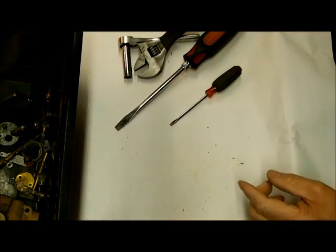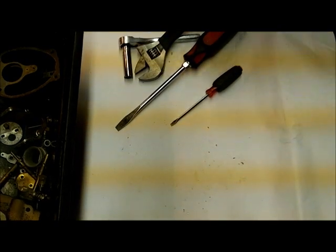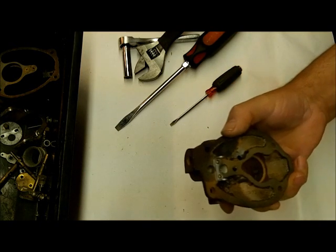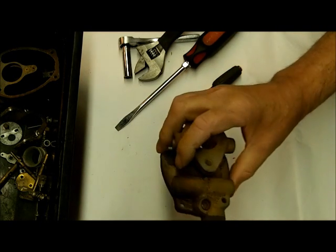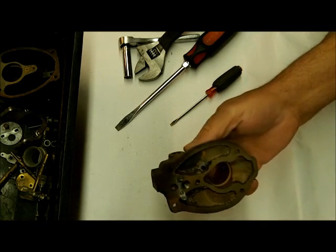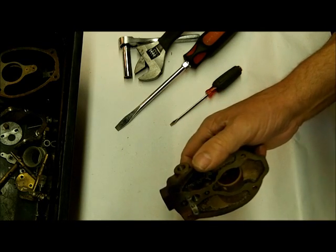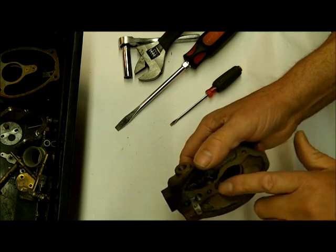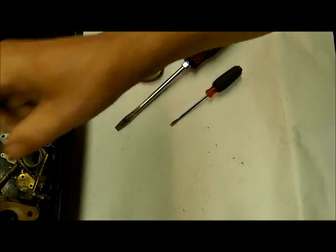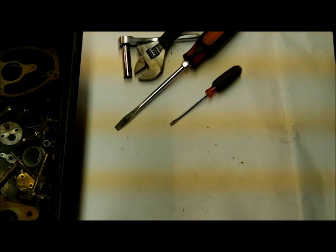What we're going to do now is put it in the cleaner and clean it. I have a soda blaster — don't use any kind of bead blasting on any carburetor. The media will chip away at your metal and could damage it; it'll get stuck in the orifices. Soda you can pretty much wash out, so that's the way to go. We'll continue on with putting it back together as soon as we get it all cleaned up. Thank you for watching.